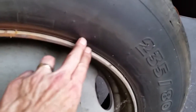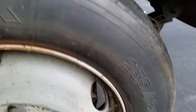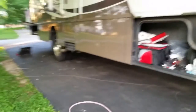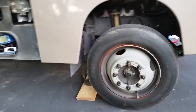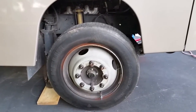If you notice up close, these tires are starting to get a little bit of cracking on them. They're about five years old — the tread is great, they just age out. For some reason only the front tires are doing that; the outside rear and inside rear look great. So I'm going to take the front tire, move it to the inside rear, and take the inside rear and move it to the front.